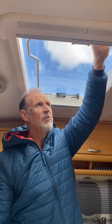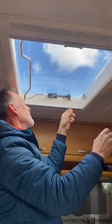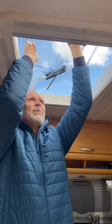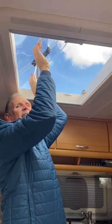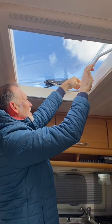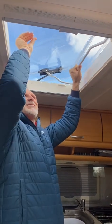The best way to get rid of heat in the caravan is using the roof light. One thing to be careful of, especially here when it can get windy: you can put it on vent by lifting it up a little bit and these locks can then lock it in. There's a little button you need to press to turn them, or you can open it all the way — but please only do that on a day that it's not extremely windy. If you want it open more than venting, this handle comes down; pull it to this point and these little locks come across to stop the wind lifting it up and ripping it off, which I have seen happen.